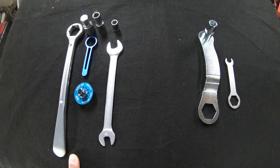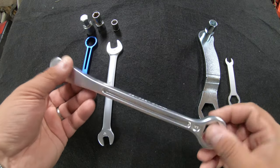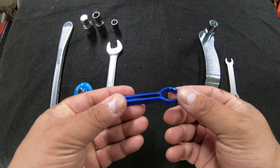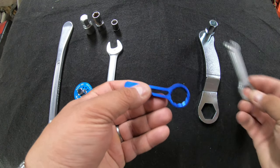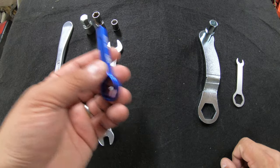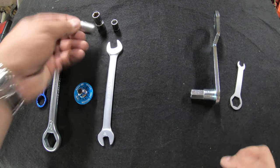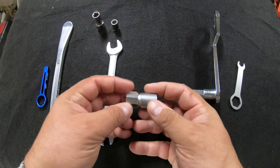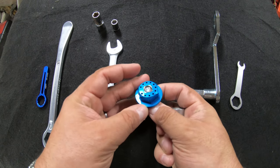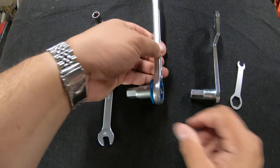On the other side of the bench is what I've used so far. First I have a Motion Pro 24mm combi spanner — it's a tyre lever at one end, made out of alloy, and a 24mm ring spanner at the other end, which replaces that on the Rally Raid wrench. Next I have a 17mm float bowl wrench which does exactly the same as the ring spanner on the end of the mini wrench. I don't have a hex wrench in my normal kit for that 14mm, but I do have a 14mm — I think it's a Draper, actually for removing an oil plug on certain cars — which I use for my front axle. To make it work I've got an adapter for the 24mm wrench, then this whole piece fits in the end — so that does essentially the same as what's on the end of the trail wrench.